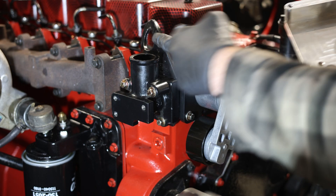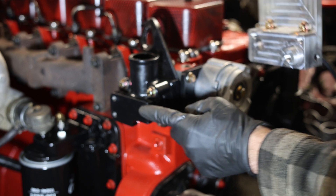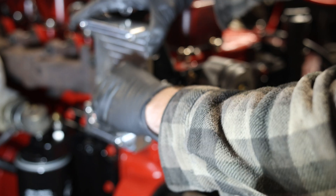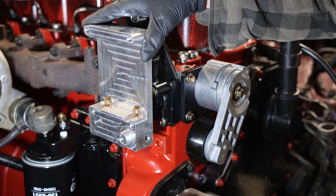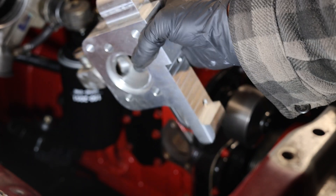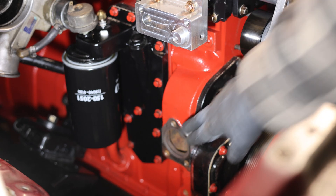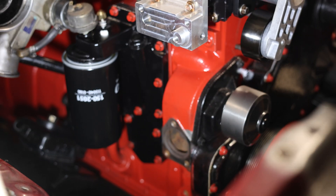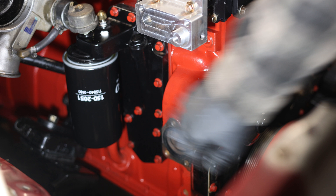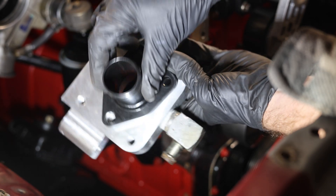Now with the water inlet installed along with the lifting hook, we have the upper AC mounting bracket. It has three bolt holes that accept the AC bracket piece, so we put our 10mm fasteners into the threaded holes and leave a little play until everything is tightened down. Now we can install the lower alternator bracket, which is also the water outlet part of the bracket that holds the coolant elbow. It installs with two different seals — one in the outlet port of the block and one placed in the bracket for the water outlet, and this all gets bolted on as one sandwiched piece.